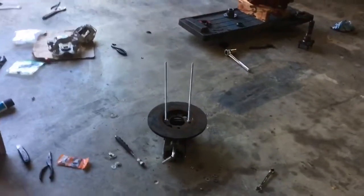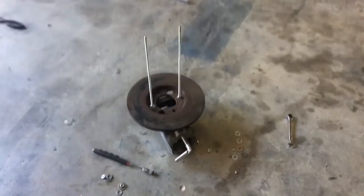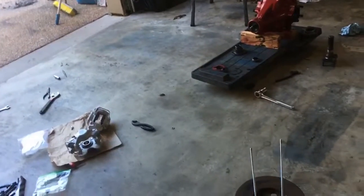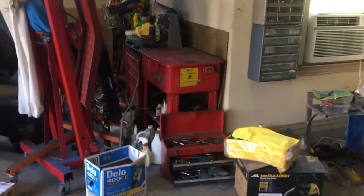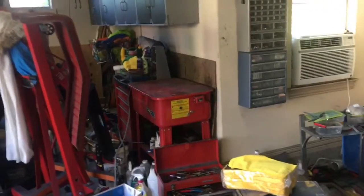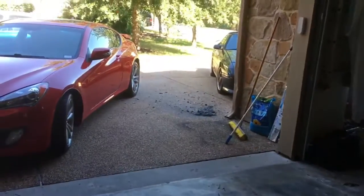All right, so the dowel, or the threaded rod, and the brake calipers proved to be a great technique. So I will hang on to the old ones and the rods until the springs can come out of the purple power, which I'll probably leave in there for a couple days. And then they'll have to go into the bath. You see Derek's got to clean up his paint stuff still.